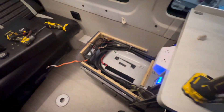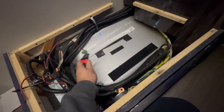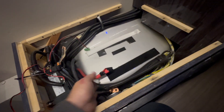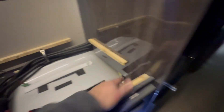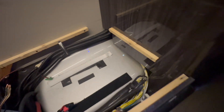This is where it was. I've already pulled it out and taped off my positive, but the 3000 is going to be tough. It's about 23, 23 and a half inches tall, and that's pretty much all of this space to the transfer switch. I need to make more room. My plan is to cut part of this cabinet out to make that work. I already took a look and there's plenty of room back here — there's this dead space — so I should be able to cut this out without a problem. That'll give the inverter enough room to snake its way in there.